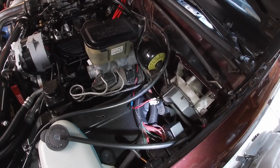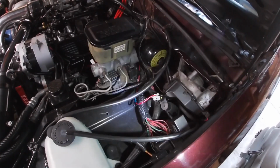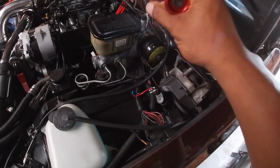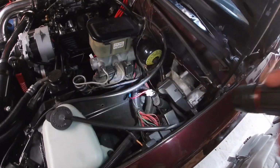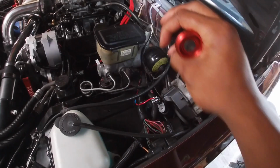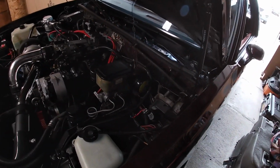And what that did was the mechanical part of the speedometer cable spun the generator, and there were 2 wires coming off the generator, and that went into the cluster. That was kind of like my vehicle speed sensor. So that generator would calculate the correct pulse that went in through the wires and into the dash. And so that's how I got my speed to work.